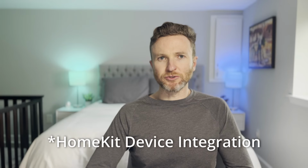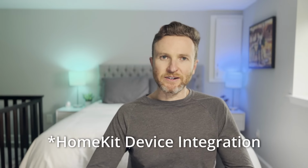I tried every combination of removing the lock from the Apple Home app, unbinding from Apple Home in the U-Home app, force quitting apps, restarting Home Assistant, removing batteries from the lock, and even resetting the lock multiple times, both by removing it from the U-Home app and pressing the physical reset button. Still, HomeKit controller and Home Assistant could not discover this lock. If you have a known solution for this, please share it.